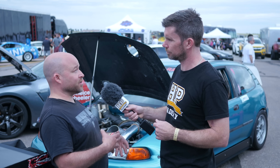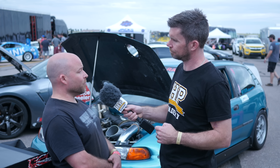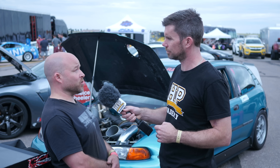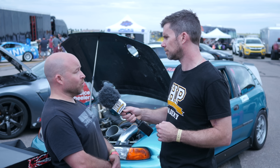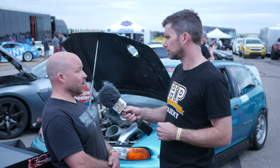Not having that dog box, any amount of time that I'm wasting shifting I'm losing boost. That's what was going through my mind with the synchromesh box — you actually are forced to use the clutch to shift, so when you've got a large turbo on an engine, even with 3.5 litres capacity, it's likely to drop off boost and you get a lot of lag coming back into that next gear, which is where the dog box with flat shifting is an advantage. So what boost levels are you running to make that sort of power? We've run it up to 41 pounds. We did have some issues at 41 pounds but it wasn't the engine at that time, it was the inlet manifold. At 37 pounds, the fuel flow was approximately equivalent to 1,140 horsepower, comparing to our other race cars where I have data to reference.